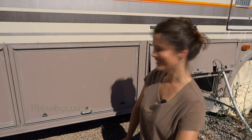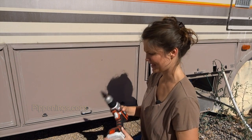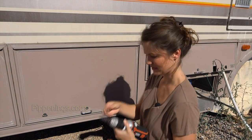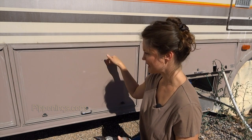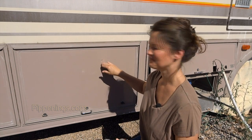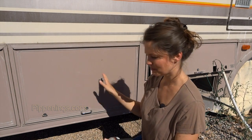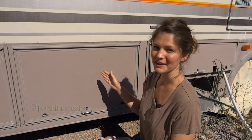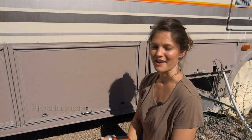I've never done this before, and like a lot of things, I'm just going to use my step bit because it's pretty powerful when it goes through metal. I've got metal on the inside, there's wood in between here, and then this is a thin fiberglass, so it should be pretty quick. I'm going to put a hole — that's just going to be my pilot hole — and then use my oscillator to get the rest out.